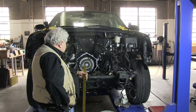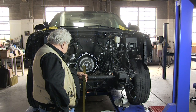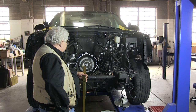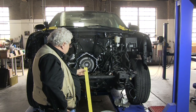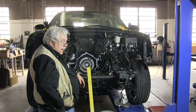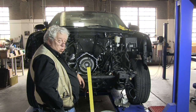And so the front, we've got largely disassembled, the engine removed, and we're able to check some basic measurements, and what we're finding there is very, very encouraging. We have adequate room, not plenty of room, but adequate room for everything we want to do in the front of this vehicle. And our original projection of taking two 11-inch motors and putting them together on a single shaft for this automatic transmission is working out very well.